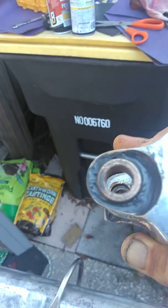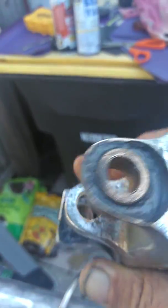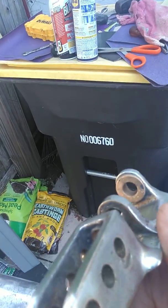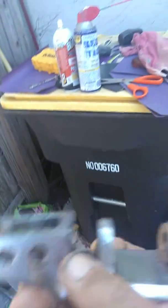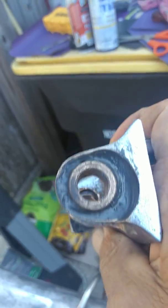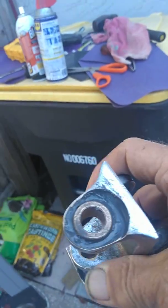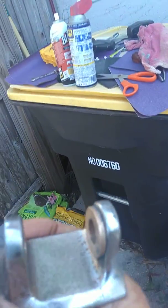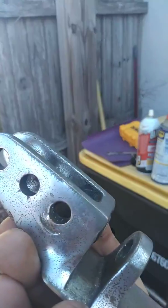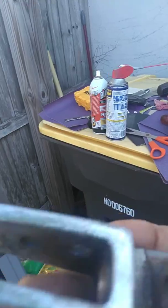Here is the gooseneck fitting with the new bushings installed. I think I showed you all a picture of that. So no more sideways play in that thing — it's really tight and it's a good fix. I put these in with press fit with JB Weld, so they are definitely not going to come out. I'm going to paint it along with the mast.